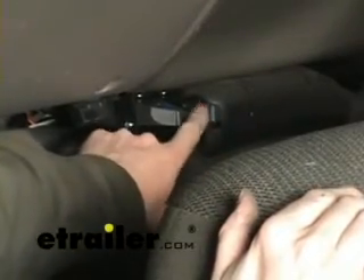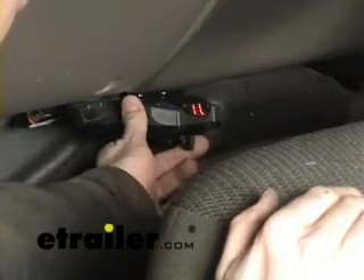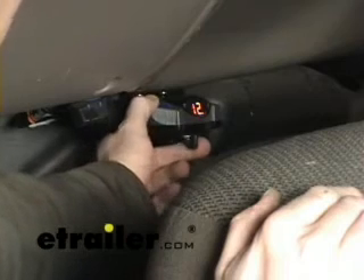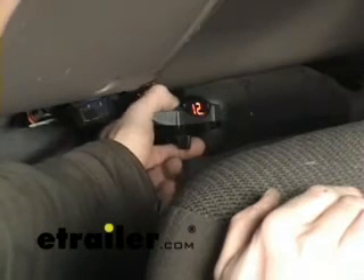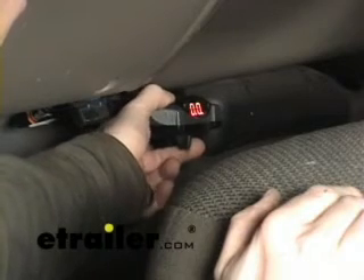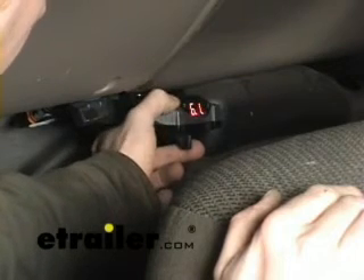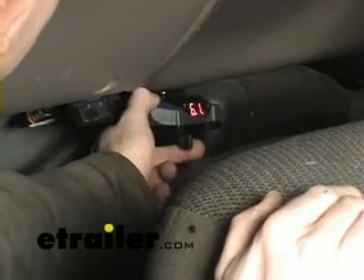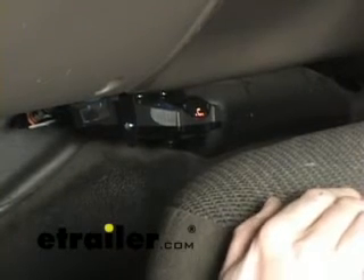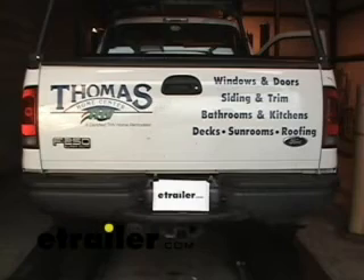Plug your test device in. You can see here we have a C for it — it's connected. We'll go ahead and test the manual override, and it starts sending out voltage. It looks like it's all the way up on the scale of 1 to 12. We'll just check the dial to make sure it works all the way down and back up. We'll leave it about right in the middle — about 6 is a good way to start testing and to fine tune it to what kind of load situation you have on your trailer.